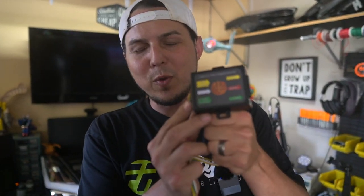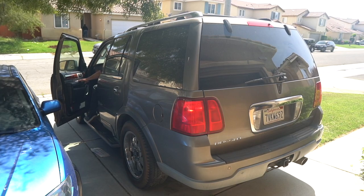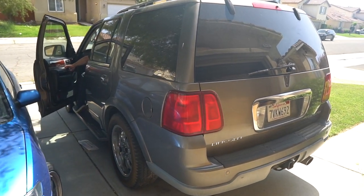This is a two-wire to three-wire converter. This is something you're supposed to put on your vehicle if it puts out the same lights when you step on the brakes as it does when you step on the turn signal. If I give both of these turn signals power at the same time, it's the same thing as on a vehicle when you step on the brake and both brake light bulbs light up.